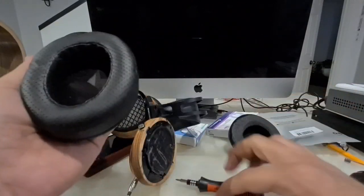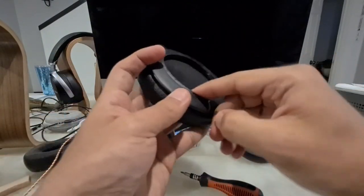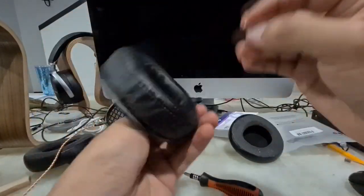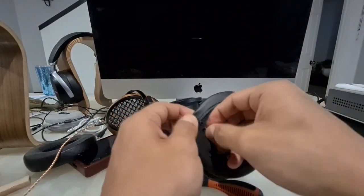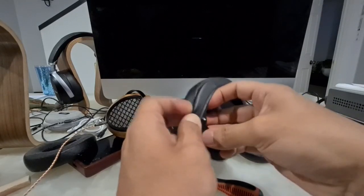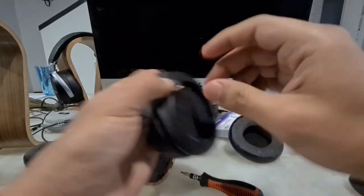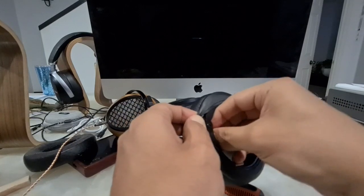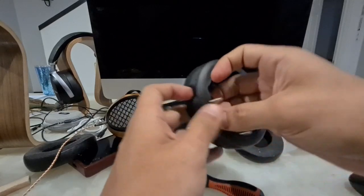Now what you have to do is put the screws back in place. To do that, you have to insert them from below. Make a space here, push this aside, look to the side so you can see the hole — and don't insert the screw from the top, insert it from below. That way you avoid having to make a hole in the mesh fabric that covers and protects the driver. Here I'm already inserting it and the first screw is in. Now the second one — same procedure. Push the tab a little bit.